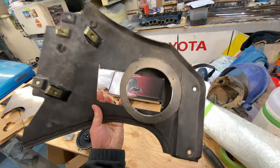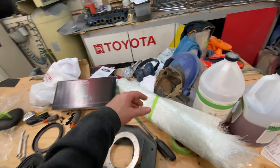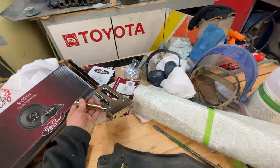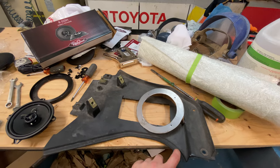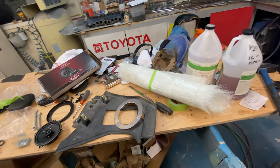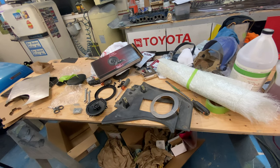A little ring I've made for the driver's side kick panel is a piece of cardboard box, cut and glue-gunned — that's temporary. All this will get taped over, then I'll lay the fleece I picked up at the fabric store. It's stretchy and I'm going to stretch it on, stick it to the back side with contact cement, then staple along here to pull it tight and take the shape it needs. I want to build the same thing for the passenger side so I can do them both at the same time.